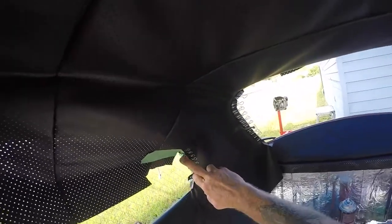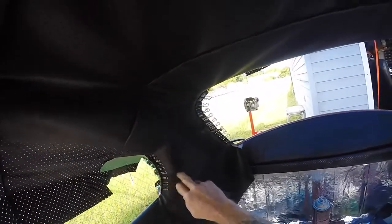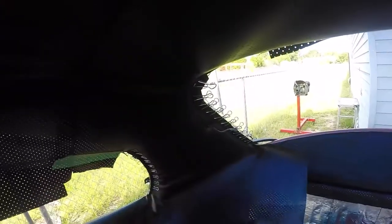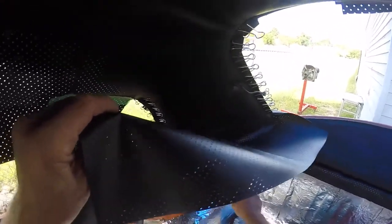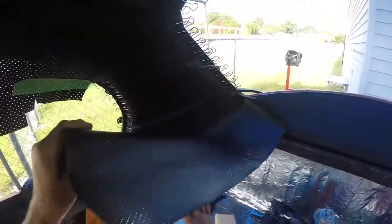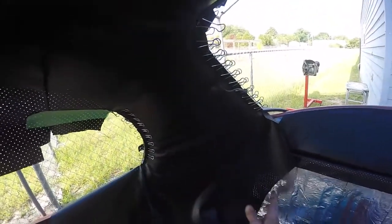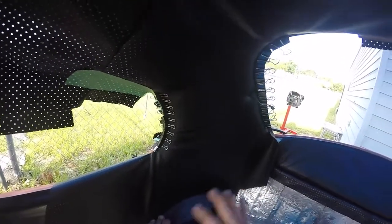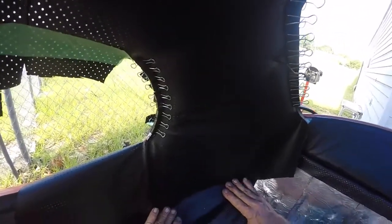Let this dry nice and good, then heat this whole area up with your blow dryer. Do not put glue anywhere above here — right here at the wheel well — that's where you put it. You want your excess because your carpet's going to go over it. Heat it up, pull it down real tight, and work those wrinkles out. Put glue on both sides, let it get tacky, and be careful — that stuff goes everywhere no matter what you do, even with an adjustable tip.